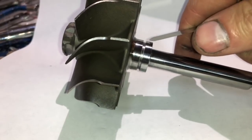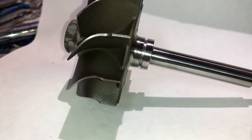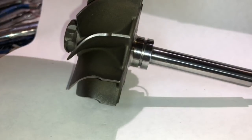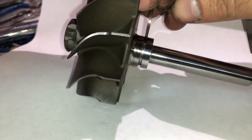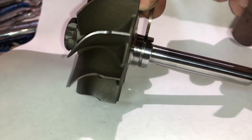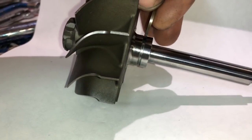Make sure that this area right here is not damaged. You can also check the piston ring groove gap right here to make sure that it's in spec. If you put the piston ring on — you can do it this way too — I got two and a half thousandths here on this new turbine shaft and piston ring. Feeler gauges are pretty cheap; I paid five dollars for this one at my local auto parts store, Advance Auto Parts.